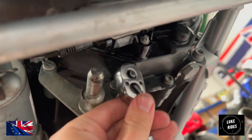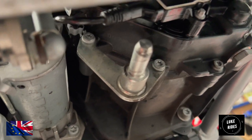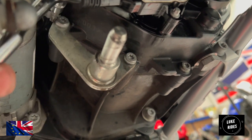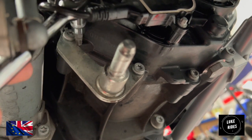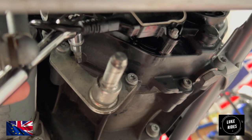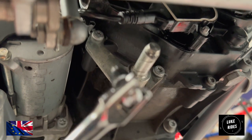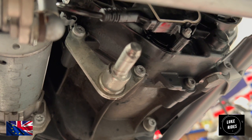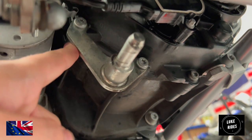So you'd be wondering, well, I can get this ratchet there. And this is where you need a thin tool like this from Blue Point that will just about get you in there, where you can then just push that electrical wire just out the way, and you can get your T30 socket on that one to the top left. And then if you're in Britain or Europe, you would then push that way to undo. But that just took a little bit of figuring out,